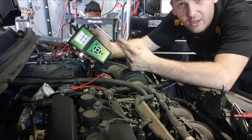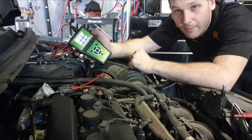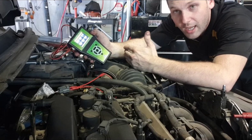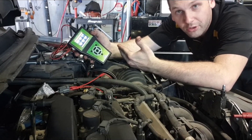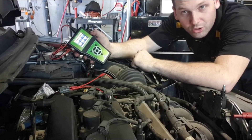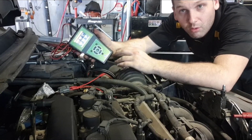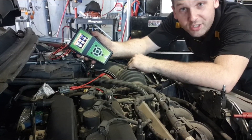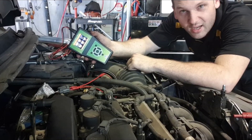It's a two-wire sensor, so it's an inductive sensor. It looks like the sensor's probably dead, but you always want to think to yourself: if I replace that sensor and it still hasn't fixed it, what would the next test be? The next test would be to check the wiring, check if the module works. So if we've got a dead sensor that's not outputting a signal, we want to use a signal generator to output a signal, see if it registers on the scan tool — then we know the wiring and everything's good, and we 100% need a sensor. Quick, easy test.